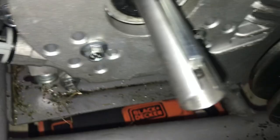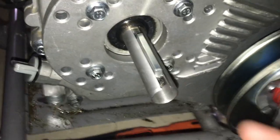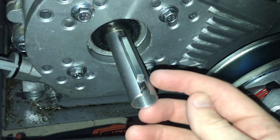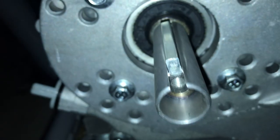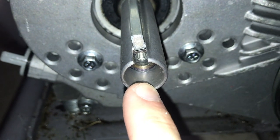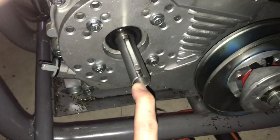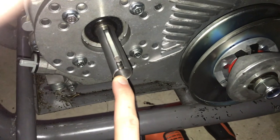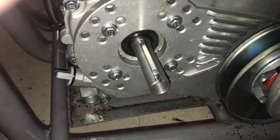You're also going to notice it's a little bit too long — I'd guesstimate about a half inch too long. So I'm going to make a mark on it and cut off the extra. You can see there's a little bolt hole on the inside of the original crankshaft in there, and we're going to need to access that to secure the torque converter in place.